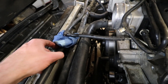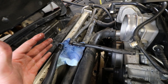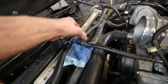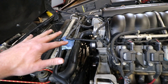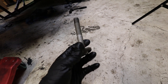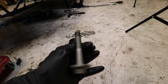So that was both a win and a fail. I got the crank bolt free — it broke loose — but I also ended up breaking this cooler line right here, this T-fitting. These are garbage anyway; they're plastic from factory. Why they continue to run plastic on the coolant lines, I don't know, but I was going to upgrade it to a brass one anyway. Crank bolt is out. I got underneath the car — it was a lot easier to get to and just unscrewed it the rest of the way with my hands.